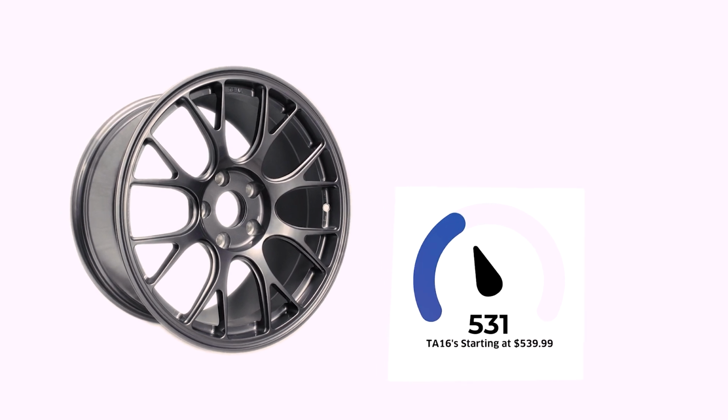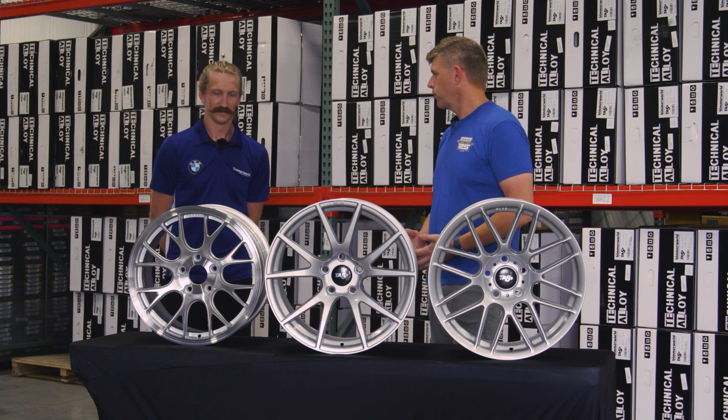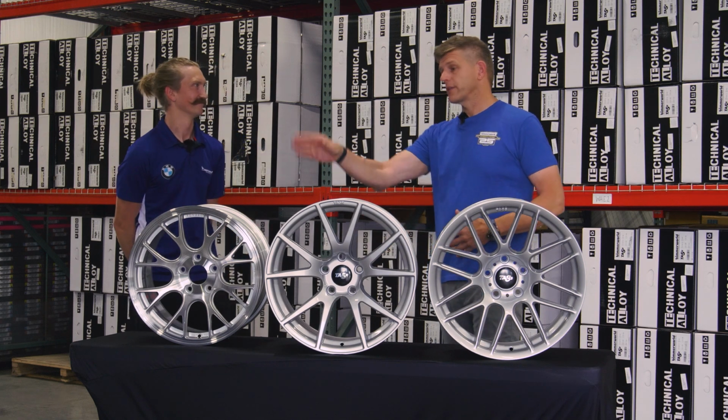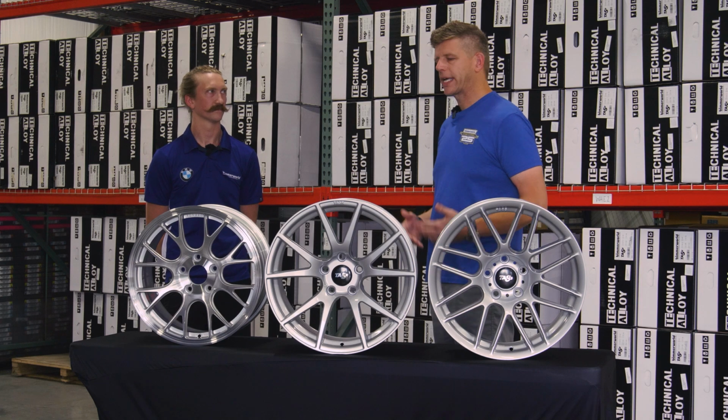Yep. Then from there, we're doing forged wheels at a lower price of entry. That's awesome, but that's not what people pick up the phone and call and ask for, right? It's Flowformed. Flowformed is basically a name for a wheel that's not a fully forged wheel, but in many cases, a true Flowformed process wheel is much better than the cast wheels of old, and they are much more structural. And again, more structural means less metal, more strength, some balance of the two.